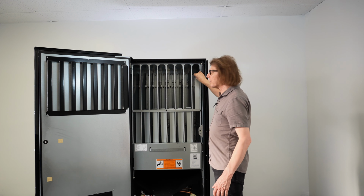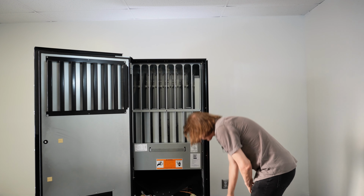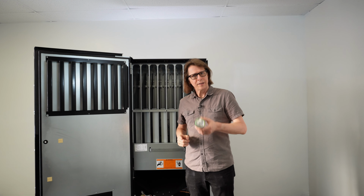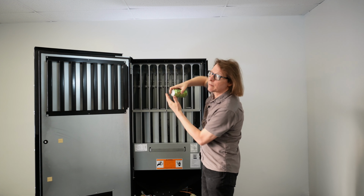We always want to have at least about a 1/4 inch of a gap between that back spacer and the very rear can. For example, if you don't have a ruler, it may be hard to get a tape measure in there, but usually a 1/4 inch is about the thickness of your index finger. So if you put that last can in there, and you can get your index finger between the can and that back spacer, then you have enough play for the can to move back and forth as it's being dropped. And that's going to go for every type of product size. You always want at least a 1/4 inch gap.